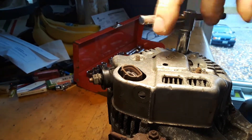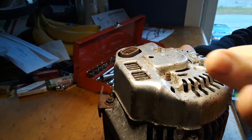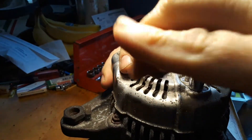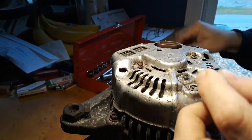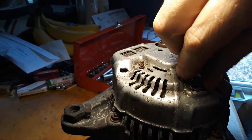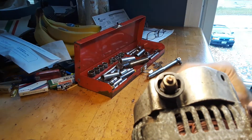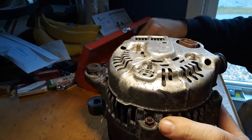I know this is kind of an older car, but the process is reasonably around the same. This looks like it's got some sort of a metal tab going from here to here. We'll take it off anyway and see what happens. This rather than being a nut like the rest of them, it's actually a bolt, and it does have some sort of ground strap on there. This is the main battery post connection — this goes directly to the battery. Let's see if we can find the right socket for that one. 10 millimeter.